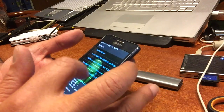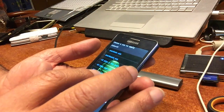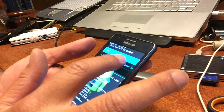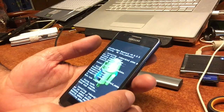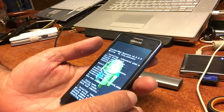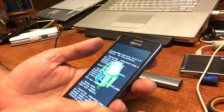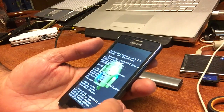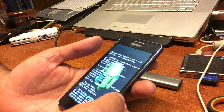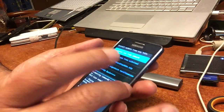So we go to install zip and choose zip from SD card. You will see I called the zip the S2 Plus iOS Droid V1 zip. Just go ahead and install it. Everything should go fine. This is special for the 9105P only. If you're going to install this on the 9105, you might get an error — the one for the 9105 won't work on this phone.